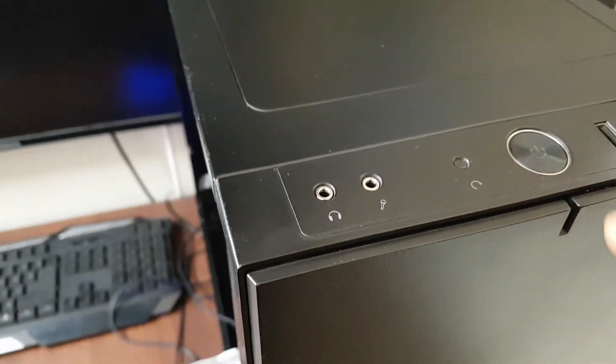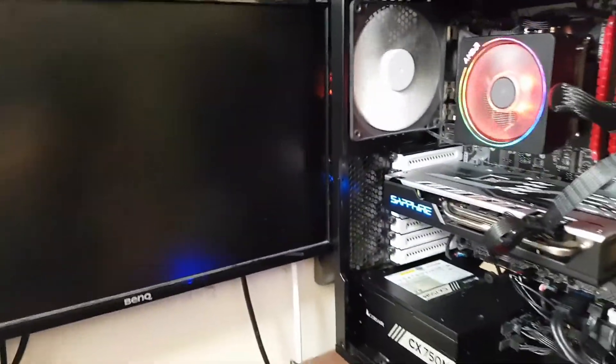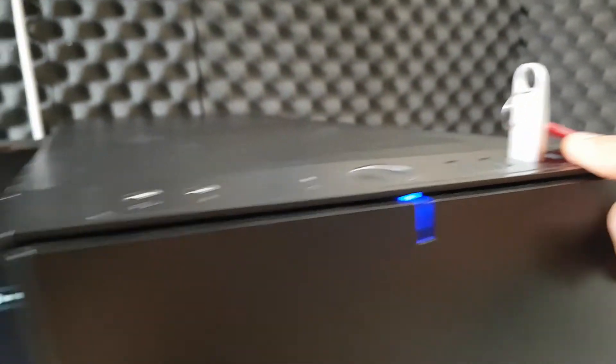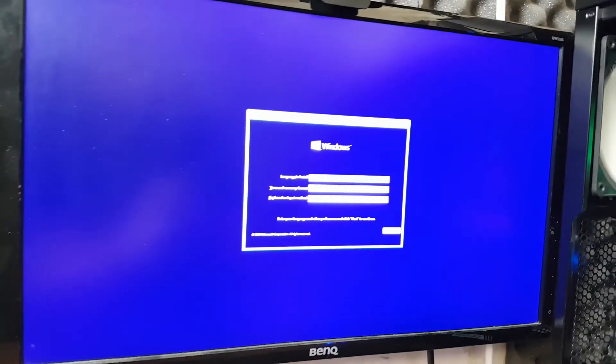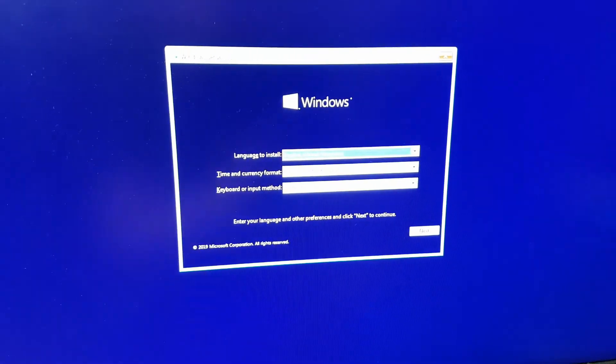Now turn on your computer and wait for the magic to happen. In theory, if it's a new computer with a new disk and nothing else, it should boot straight into your USB drive. We've just had a beep code for good POST and we should see the purple Windows logo for the first installation aspect — there we go. If you have this then you're good to go and we can move to the next step.